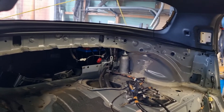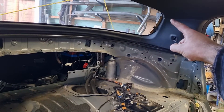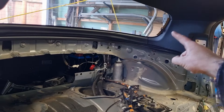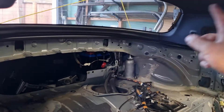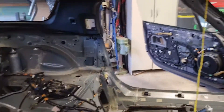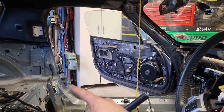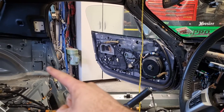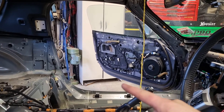And then down. We'll obviously have the rear laterals coming down to this back corner down here, and we'll do something across in the middle — not quite sure yet, depends what the customer wants. The side intrusion, being that it's a road car, will be nice and low. It'll come from the main hoop down and basically follow fairly low along here.